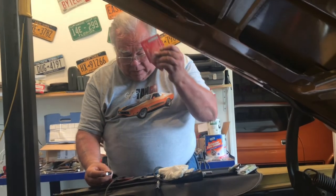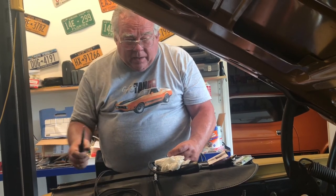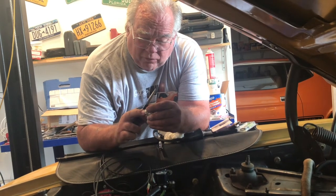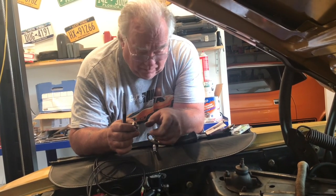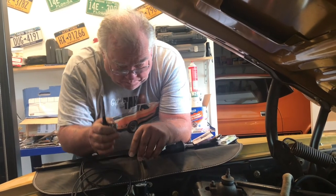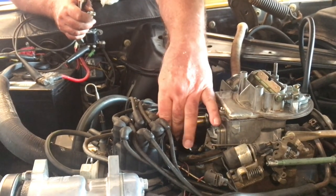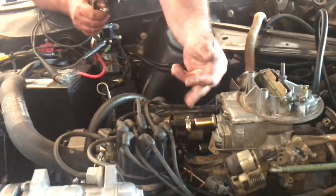Well, I had another clamp. I took it out, took off the other clamp, and made sure that there was no further little tang inside. Put them on, tightened them down, but I did not tighten them down to where it's crushing anything. I just want to make sure it was tight enough so if I tried to turn the clamp and hose, I couldn't. That's all the sealing I need. No more.